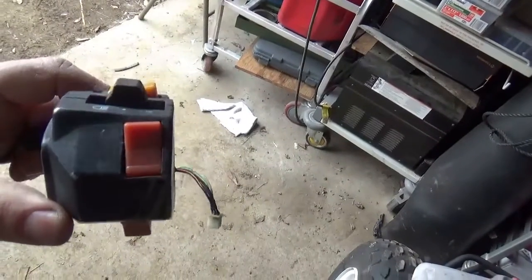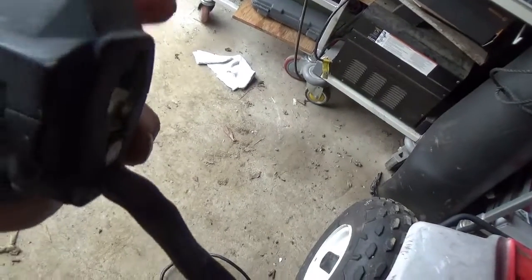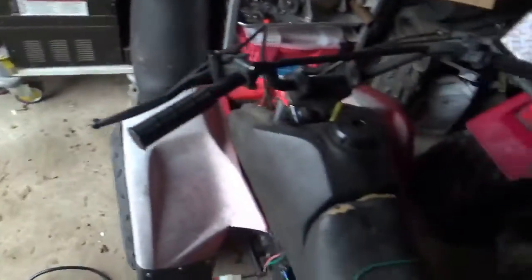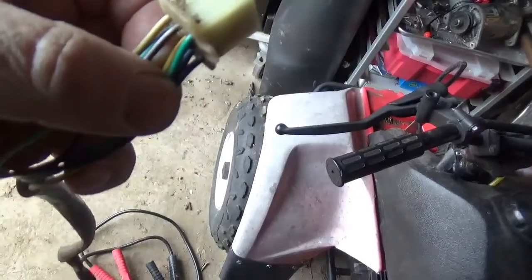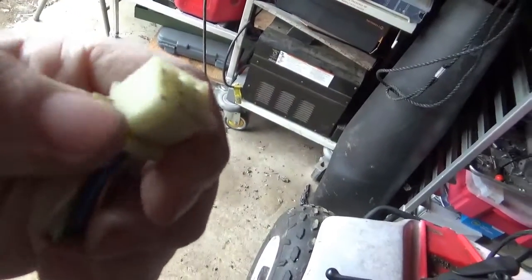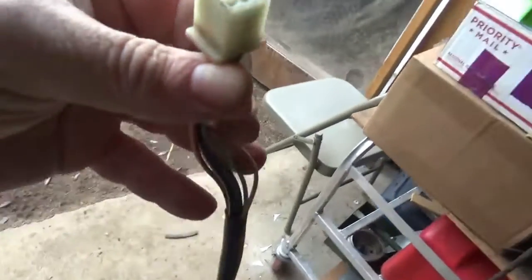You might ask why I came up with my own push button on these hacked wire harnesses. The thing that seems to go first is the starter button — that's probably the first thing to go bad on these OEM controls. The second thing is there's really no universal wiring or color coding on them, so unless you want to spend quite a bit of time figuring out which wire should be hot and which should be ground from the starter switch, it's a lot of work. You could take the whole thing apart and figure it out, but I just thought it was neater putting a clean little button on.